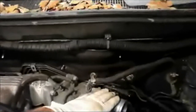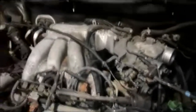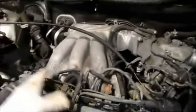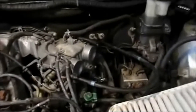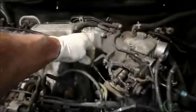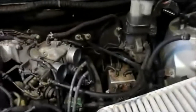And now that we have all the bolts tight in the back, all of the bolts that we had taken out are now tight, all of the manifold are tight, we're going to now plug in everything that's up on top here on all of these sensors. Vacuum lines are all reconnected. These vacuum lines are actually going to go back to the air breather. We're going to put that on momentarily. Our lines are connected up for the cruise control as well as the accelerator, and we just have to lay in the air breather, reconnect our vacuum lines and the mass airflow sensor, and we should be ready to fire it up.